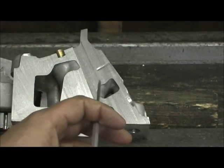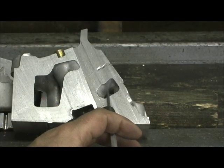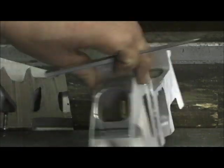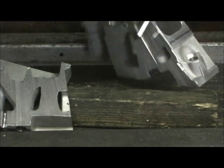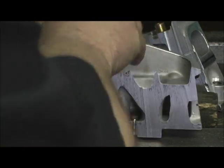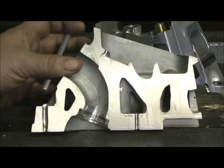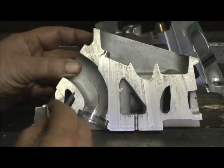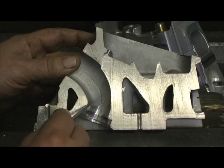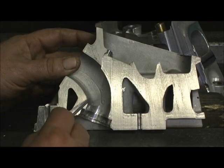And again, you know, we have a water jacket right here pulling the heat away from the head, but it's not going to be in no way in an area, as you can see, that you're going to be grinding, because people, if you're grinding in here, you're doing something wrong. You do not grind the floor. If anything, you'd add material to it.